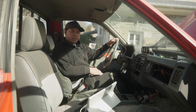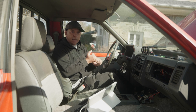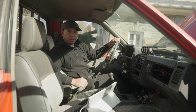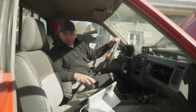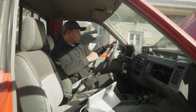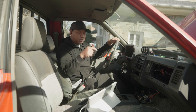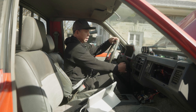We're ready to start the engine for the first time. Double-check that everything is connected — vacuum lines, fuel in the tank, oil, all the basics. Make sure MegaSquirt is on the main page so you can monitor all the sensors. When you crank the engine you should see the RPM spike up a little bit, which means you're getting signal. Make sure your transmission is in neutral, and hopefully it starts.